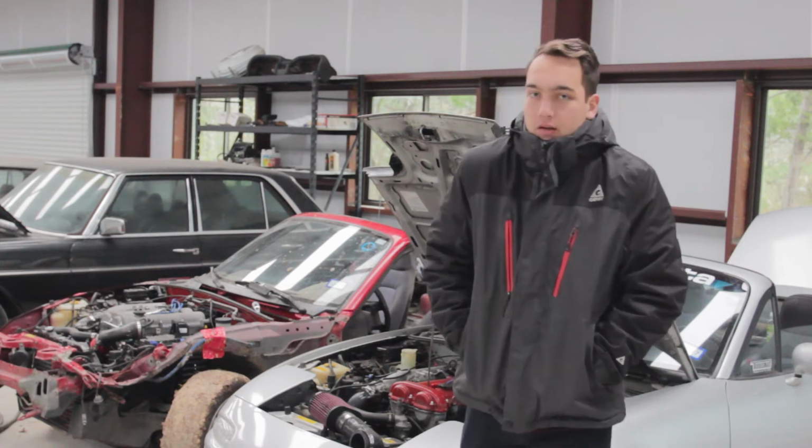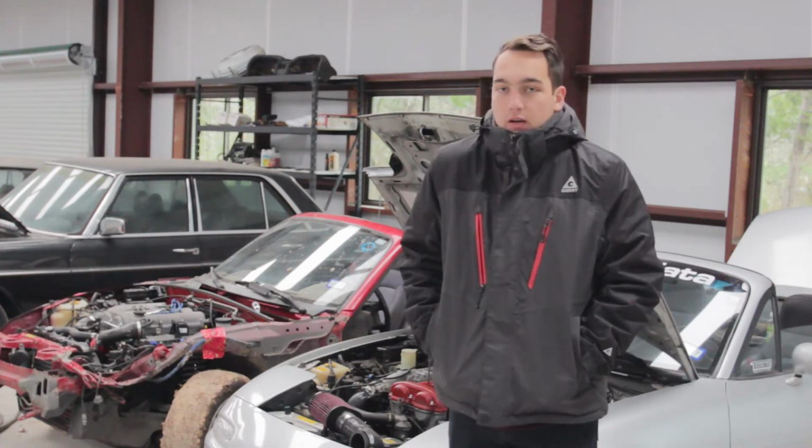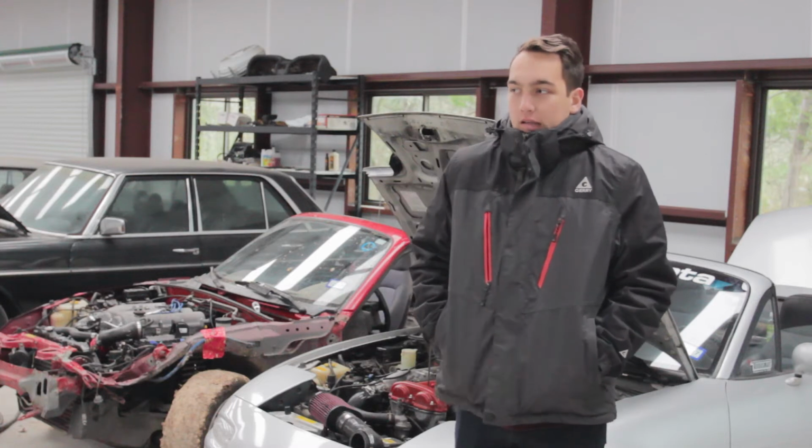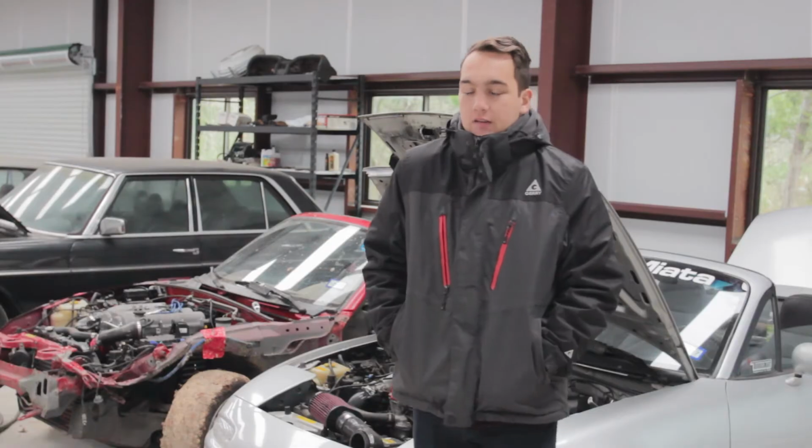So today, plan is to swap out coil packs, and hopefully that will fix our poor running issues, and if that does not, it's going to be a real fun search for some vacuum leak somewhere in the charge piping or something like that. So let's get to it.